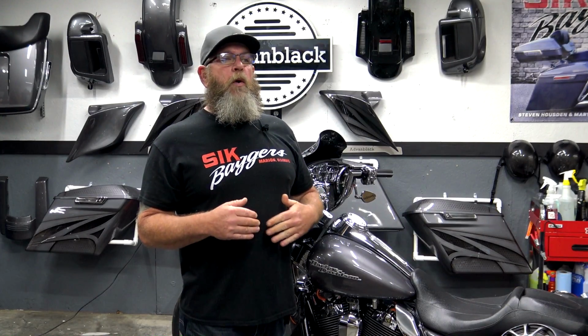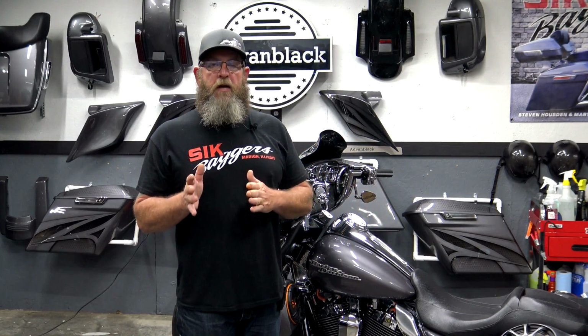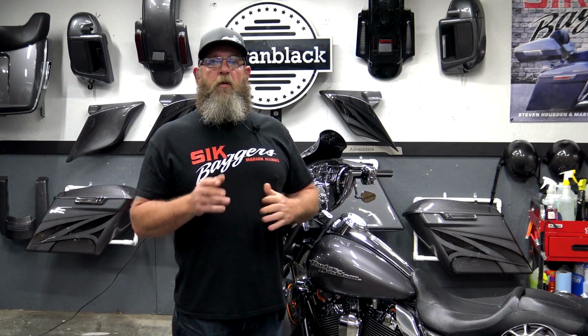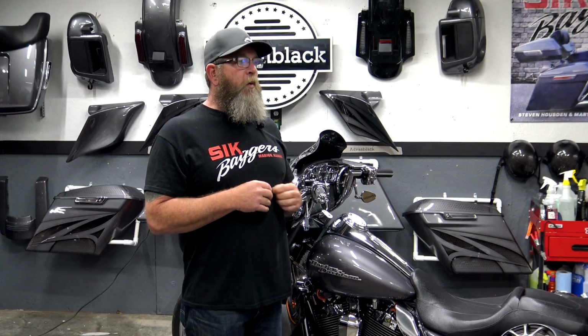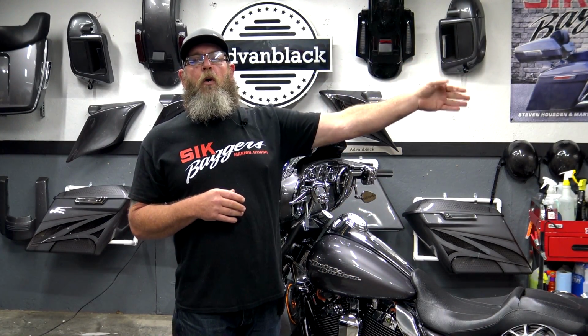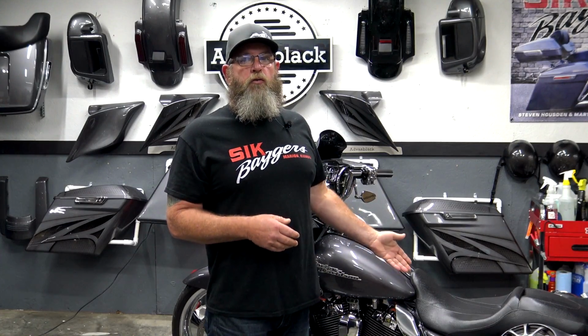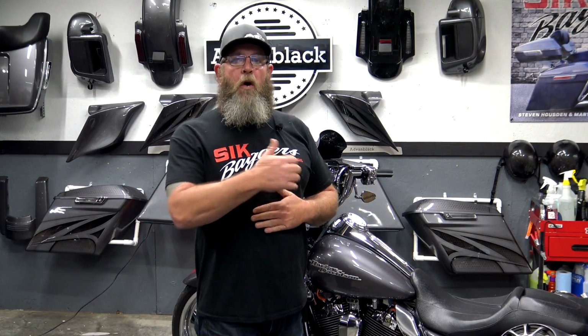It's also important that when you're doing your diagnostics on the bike and say that you've come to the conclusion, you think you know what it is, you've cleared the codes, but you want to see if it throws them again, do not simply just start the bike. Do a road test. Drive the bike down the road and bring it back in, and then check your codes. It's very important that you do that. Some codes may not throw just by you starting the bike and it being in neutral setting in your garage. So make sure that you do a road test if you want to see if you can get those current DTCs to happen again.